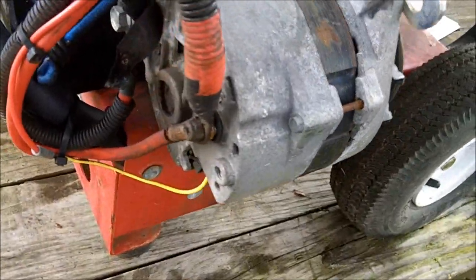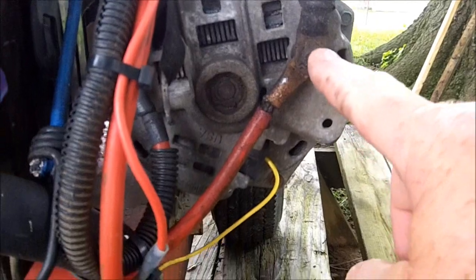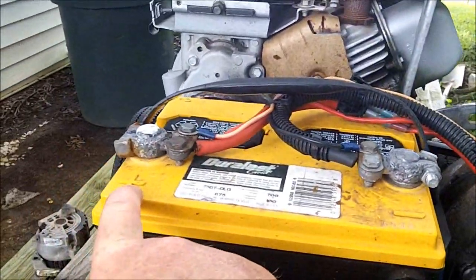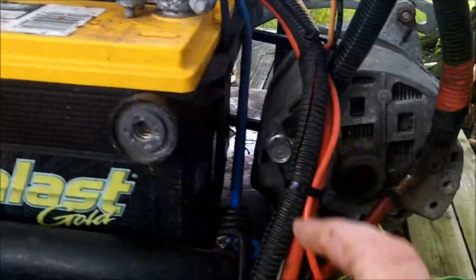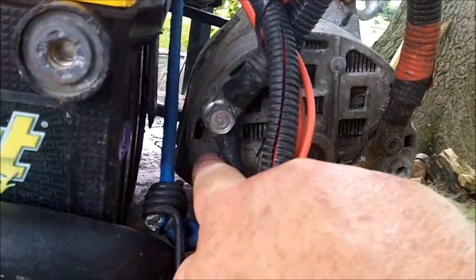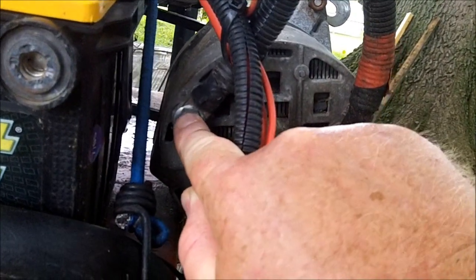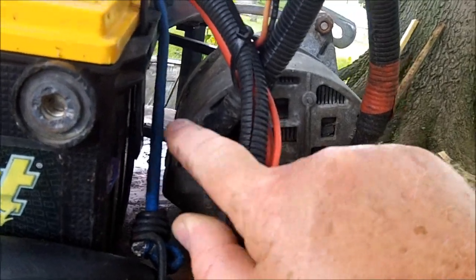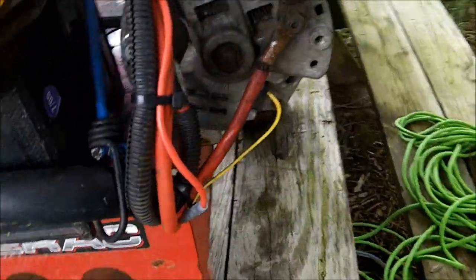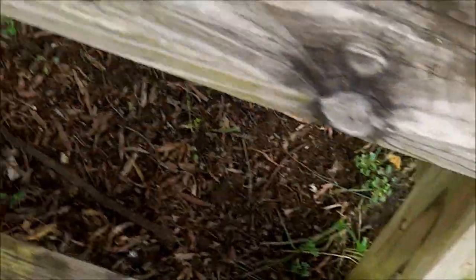Here's how I got it hooked up on the back. This right here is your battery terminal — it'll say BAT on there — and that runs to the positive post on the battery. There's a ground that goes to the housing of the alternator; it's a threaded hole that takes a 5/16 by 18 bolt, and that's the negative side going to the negative post of the battery.